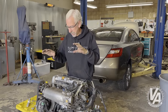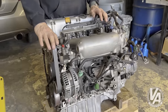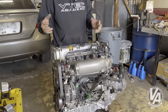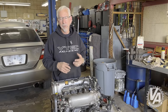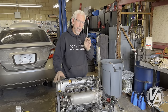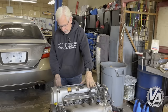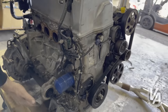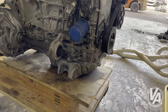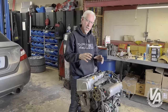One of the things we did with this engine is we left on the power steering pump. The 8th Gen Civic non-SI comes with hydraulic power steering. We didn't want to change over to electronic power steering — that was going to add a lot of wiring and require a new fuse box. So we decided just to make a new power steering hose. Another thing that has to be done with this engine is you do have to change the oil pan. If you come around to the backside of the motor, you'll notice there's actually an engine mount back here — that bracket is where the rear bottom engine mount mounts to.